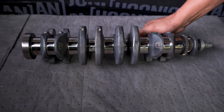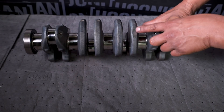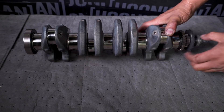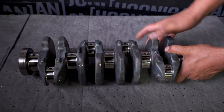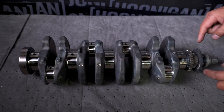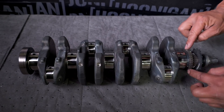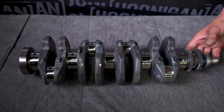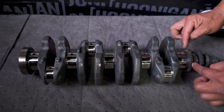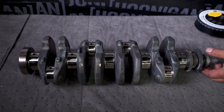Ours is probably going to go up somewhere close to about 10,000 RPM. You can see there where he took away a little bit more weight — he ground that out, ground a little bit there. How that worked was it goes into a machine and he leaves these gears on, because these gears need to be balanced also. One of them is the oil pump and the other one is the timing chain that hooks up to the cams.